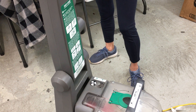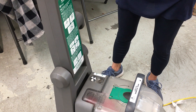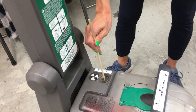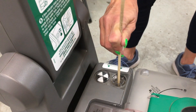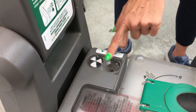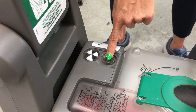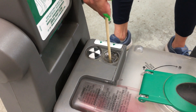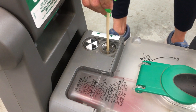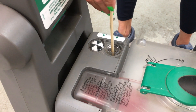What we're going to do is test the flow of the pump, because if the pump is not putting out an appropriate PSI, it's never going to start going all the way down to the bottom of the machine. In order to do that, we are going to mimic that hose plug-in by depressing an auto-load gasket right here on your small solution hose port. There is never a cap here because it is an auto-load or self-sealing gasket — press directly down with firm pressure and hold it. We are looking for a spray of 6 to 8 inches high that stays that way to indicate a good pump.